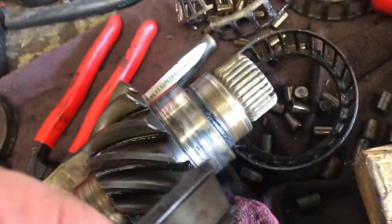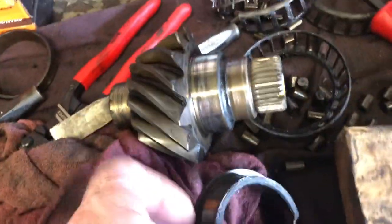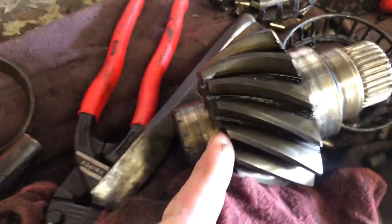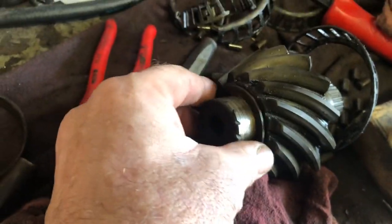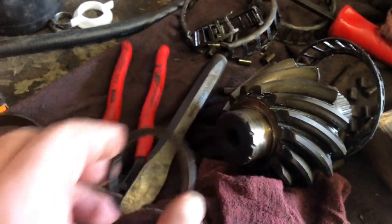There's no shim on this side, so this side of your pinion gear does not need to come off unless you can see a shim. But you can see on the back of here there's the numbers — there's nothing stuck to that machine surface. So you only have a front shim, and that's all that needs to come off. You can reuse this front shim — it's kind of loose, but I guess you line it up with your bearing when you tap it on. That's how they're doing that.